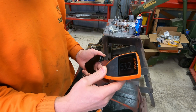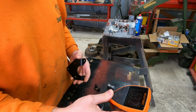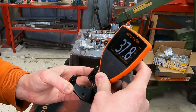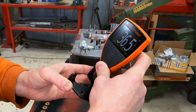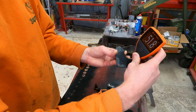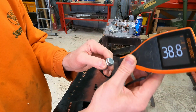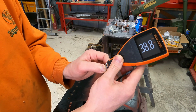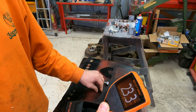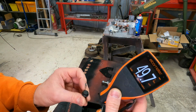I'll show you something. I have this coating thickness meter. I can check how many micrometers the coating has. The bracket I'm painting with the spray, a little bit of a thin layer, because with spray paint I could not get a very thick layer. Another side has 30 micrometers, a little bit more. Yeah, 50 micrometers. And this one, we can check the original bolt's zinc coating. It's 25 microns. Yeah, a little bit over 20 microns. And this bolt head I painted, 40 to 50, almost 50.